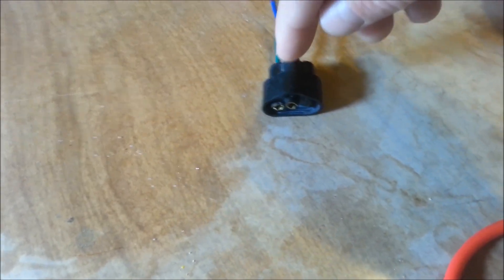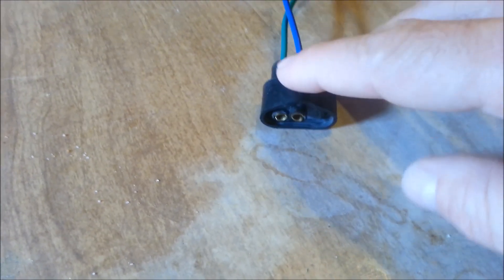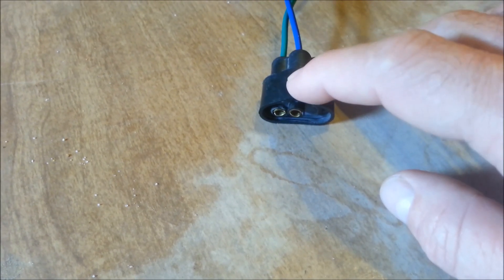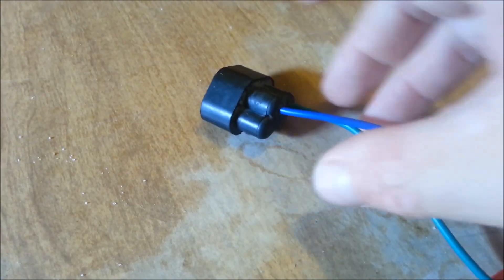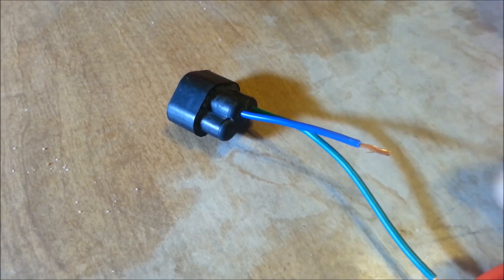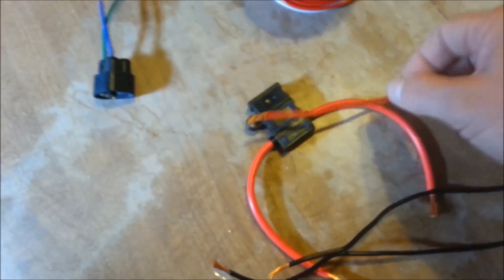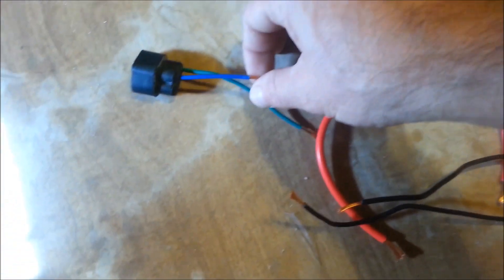The back of the alternator has two plug-ins, and this top one needs to go to the battery. Usually this goes through a fuse box or through a switch, because when the car gets turned off it will drain the battery if it's left on. So it usually goes to the fuse box so that when the key goes off, it's fine. The other two wires — either one, it doesn't matter — go to the back of the alternator. Since it's alternating current, it doesn't matter which wires are which. I like to solder mine together, but you can also use wire nuts.